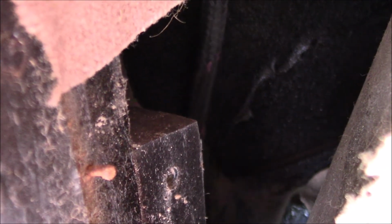There, do you see that wire that's wiggling there? Pat's just in the boot moving the wire we can see, and we know that disappears up above the door, so that should go across into the ceiling. And the way we did that is this panel here isn't actually part of the header lining, that is a separate trim panel, so you can pry that off, just frees up the tacks, and then you can just tack it back down again. And I think it runs up here and then pops out there. So we're going to get labelling and see what we can actually free up.